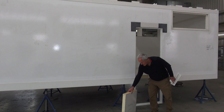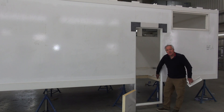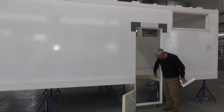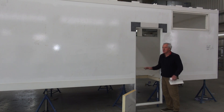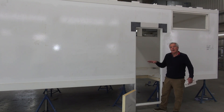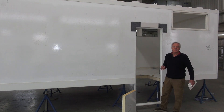The difference to the walls and the roof is the floor panel, which you can see here — it is 95 millimeters thick and it also has a wooden layer in between to make it stronger from inside. You also have 80 millimeters of insulation, and inside this 80 millimeter insulation there is also a steel structure which allows us to connect the body very well with our three-point subframe, which then connects the whole body to the chassis.